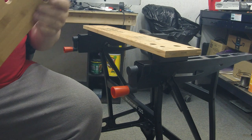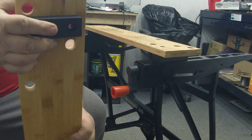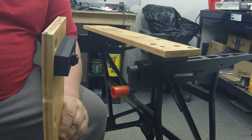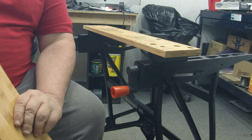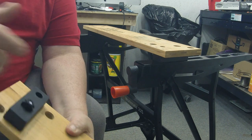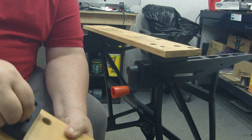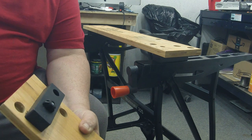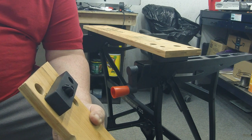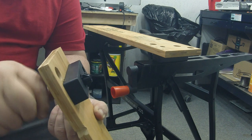Well, guys, off camera, I get down to this last bolt here, bolting through this little plastic retainer, and I'm turning, and it will not thread in. I tap it with a hammer, it won't go in. Looking on the inside of this little plastic piece, it had some flashing from when it was cast, and it wouldn't let the bolt thread in, because it's a self-threading type thing for this plastic. I had to get medieval on it, go out there and get my vise and push that bolt in a little bit to get it to start threading.